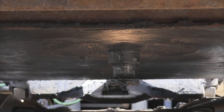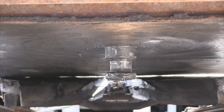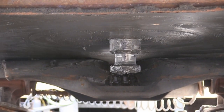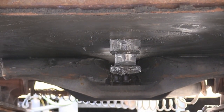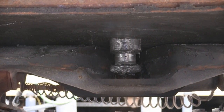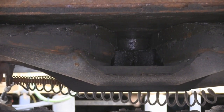As we can see here, as our driver backs up, the trailer is slightly lifted into position, and the fifth wheel skid plate slides across the apron with no gap between the apron and the fifth wheel. Then our locking jaw makes that secure connection around the kingpin. Note there is no slack.